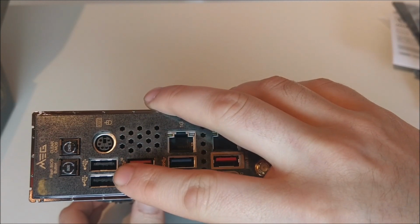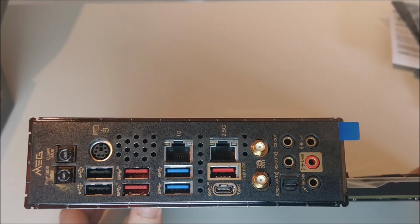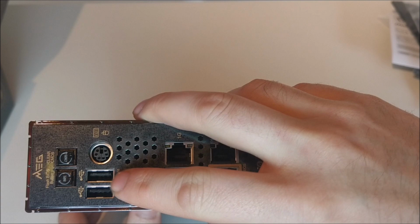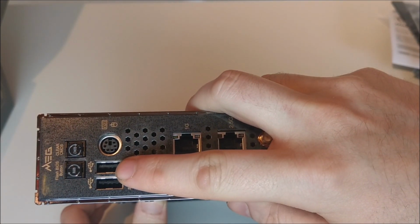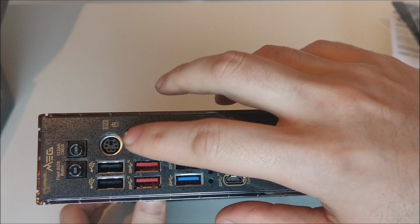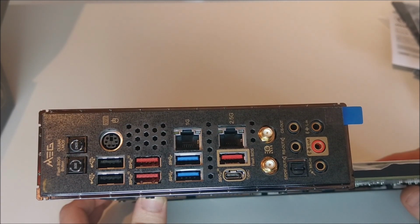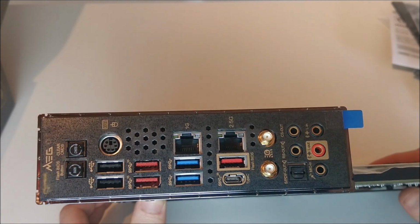This is a USB 2. This is probably here for the same case. This is probably a USB controller that works well with Windows XP. But they decided to include the PS2 also. Not sure why, if the USB ports work, but USB also takes a little bit of performance if you have USBs plugged in, especially with keyboards and mice, because when you use USB, the CPU will constantly ask the keyboard or the mouse, "Hey, what's going on? Hey, what's going on?" But with the PS2 one, you will simply only have inputs when you press a button or move the mouse. So you can gain very, very few points by using the PS2 one. It is nice to see, but we're talking very, very small point gains here, almost to the point where you can't really see them anyway.